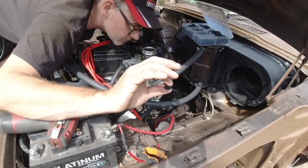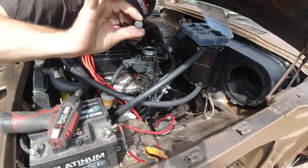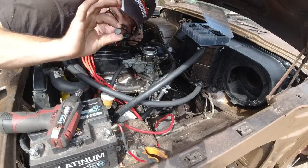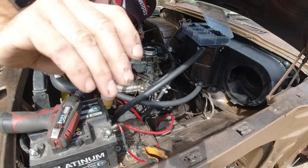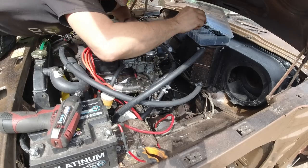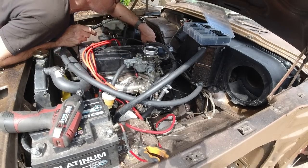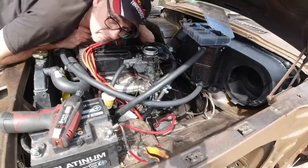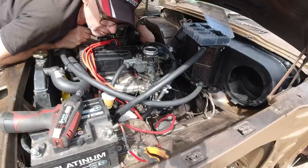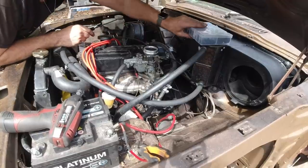Whoops, I've got stuck. What I do is burn a hole through them with a soldering iron. It's easier than using a drill. If you get a soldering iron and melt the hole to the right size that you need, slide it over the cable, then that goes to the bulkhead again, stops fumes getting in. They're not exactly the same grommet. The grommet has a boot on it normally, but we can't get them. Anyway, it's better than none.